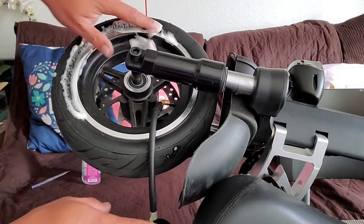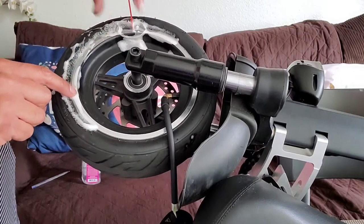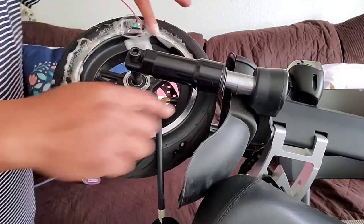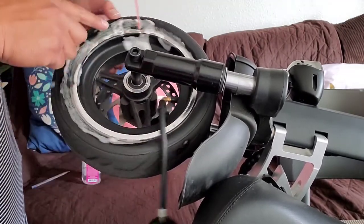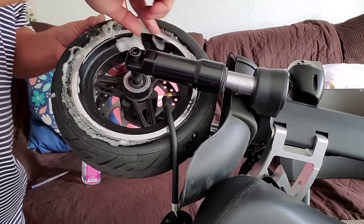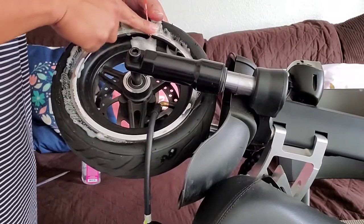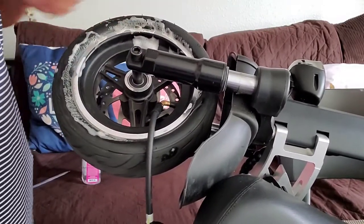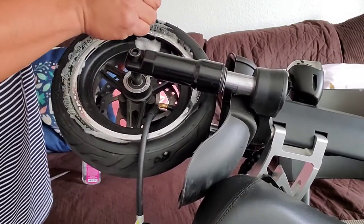Nothing worked. I was like, dang, what's going on? And finally, when I was pumping air, I could feel it, or here would be the air. See how it's bubbling right here? So you would look for this when you're pumping air in your tire. Spread it all around, so this way you'll see where the air is escaping. There was a slight dent where I had it, and it was just doing that. You hear that sound? I'm going to pull this out. Okay, so if you have that sound, let me put this back on here.